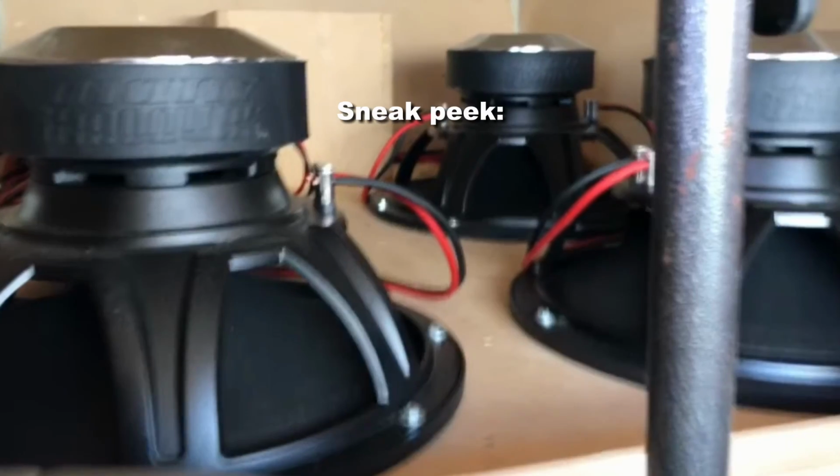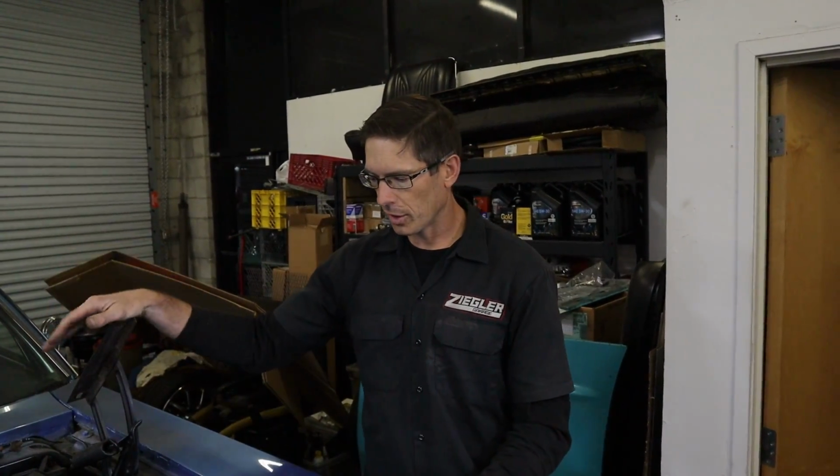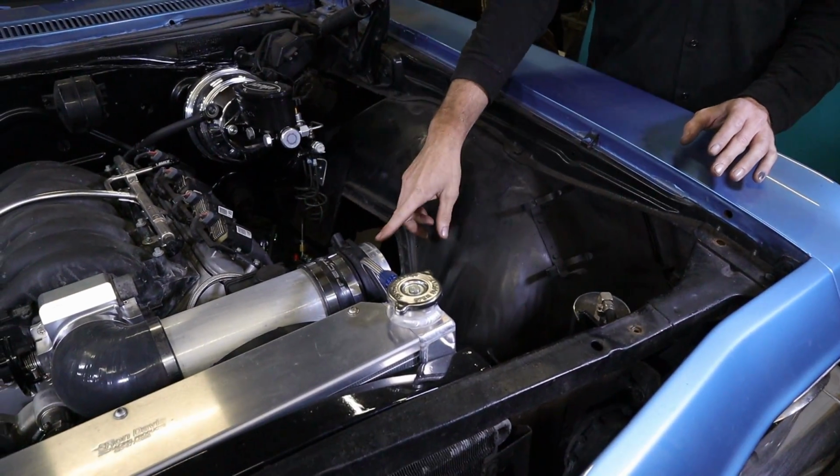So this thing we're going to show here in a minute, he went really crazy on a stereo in this thing. And he was worried about the amperage on the alternator, but to go to a more amperage, you can't even see the alternator because it's F-body drive and it's down low, but this is a 150 amp alternator. And pretty much to go to the next 200 amp or bigger, the body is going to start getting bigger and it's already running out of space down there. And the brackets, it is already done pretty much. So we didn't want to change it.